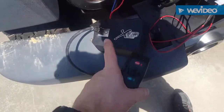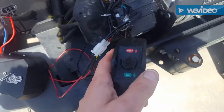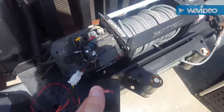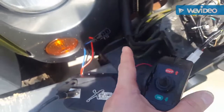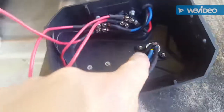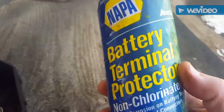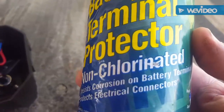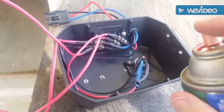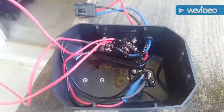Here's the factory controller plugged into the factory hole going into the factory harness on the solenoid. Works good. This plug is going to go into the cab, routed up through here for my internal switch, so you'll be able to use either one at the same time. Instead of painting liquid electrical tape on the electrical connections, I'm going to use this battery terminal protector — it resists corrosion on battery terminals and protects electrical connections.